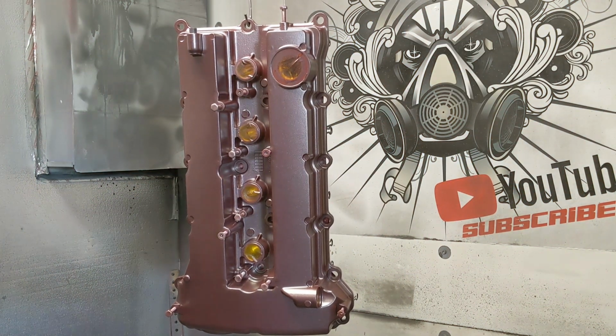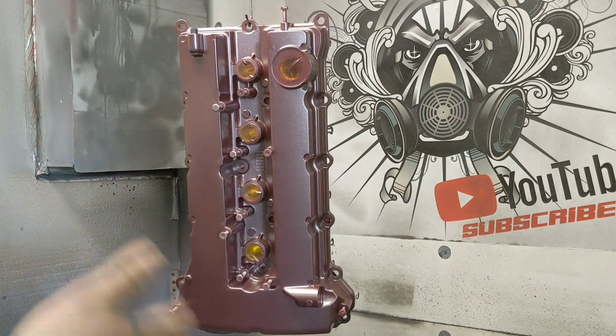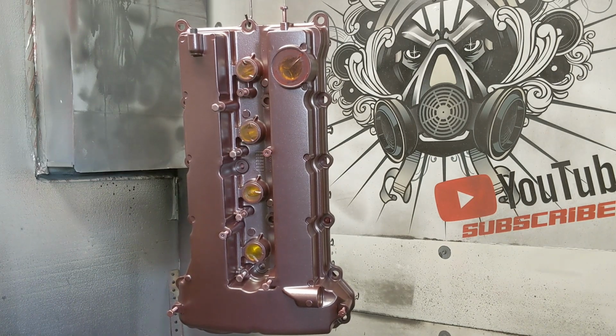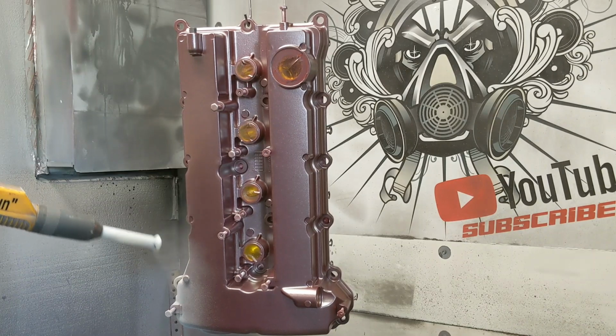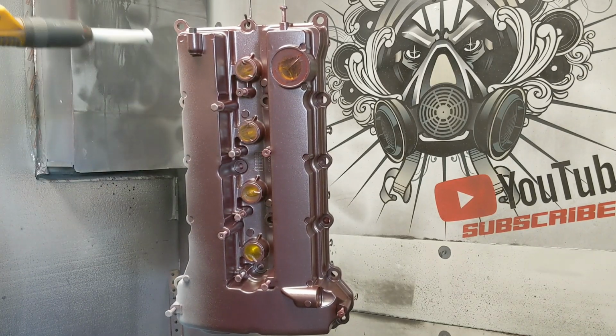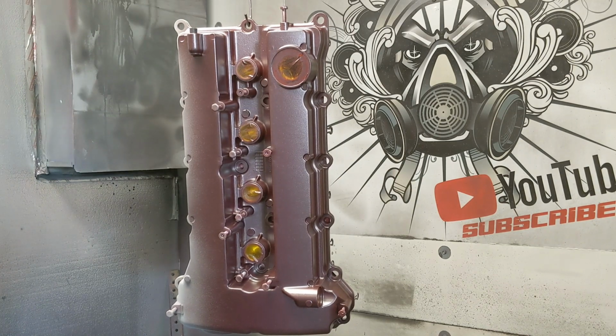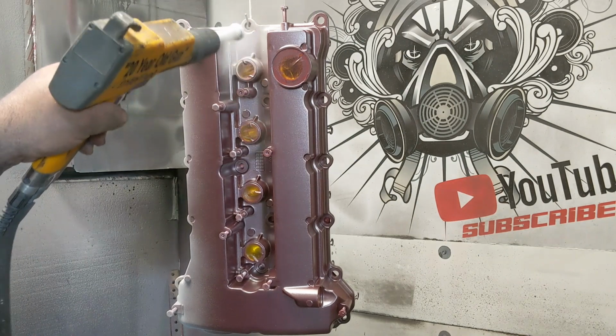Alright, ready to put the top coat on this thing. Got the KV set. It's around 35. Prismatics says below 45 if it's going over a base coat, so we're just going to guess at it and drop it down that low. I have the air pressure set pretty low right now. Just want to get some of this covered before I go at this center area.